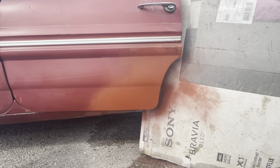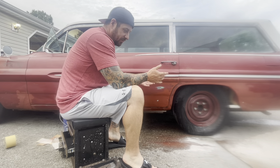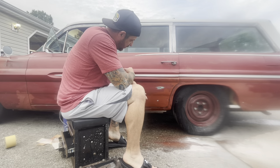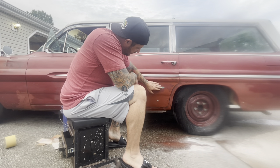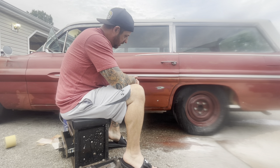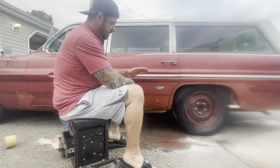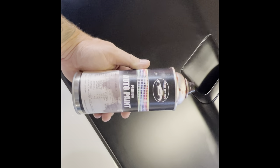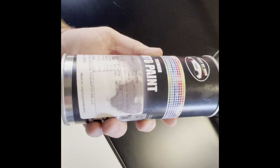I can't stress this enough — that's the whole point: when it looked terrible, you're going to be able to make it look better. A little later in the day, different clothes — I was just going to come out and blast some paint on this. I put some 600-grit sandpaper on my block and was wet-sanding the primer. Up here where I hadn't really done any work, when I was wet sanding I went through to another layer that actually looks like patina — kind of cool. But because we've already done all this work down here, we are going to try to blend this. I'll throw some primer over it, lighter this time so we don't burn through again, then put the top coat on. By the way, this paint is from a company called Paint My Ride, bought on eBay — you might even be able to take their formula to a local paint shop and have them mix a single-stage for you.